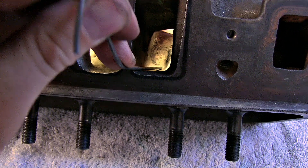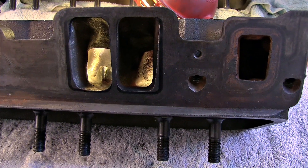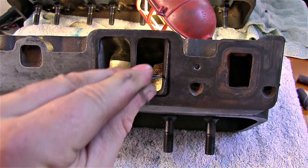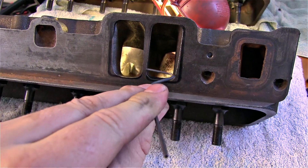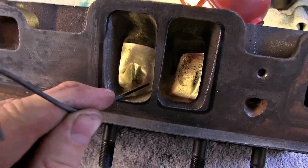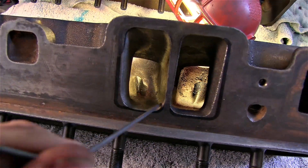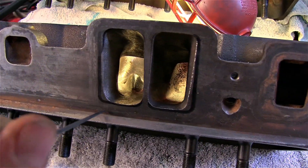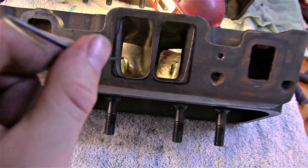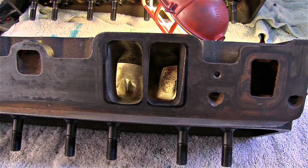You can see that little ski jump — the roof is not flat. The first thing you want to do is open up the push rod pinch area, which I've already done on one side. You can see where it's been opened up. I've also leveled out the ceiling to make it nice and flat, and I've smoothed the area around where the valves come through so air flows quickly into the combustion chamber.